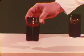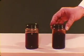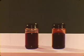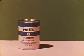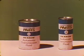In normal use, the original fluid should not require changing during the life of the vehicle. But for trailer towing or in taxi cab, police, and other heavy duty service, the fluid and filter should be changed as specified in the service manual. The Dexron type fluid used in Chrysler-made transmissions normally tends to darken with use, so fluid condition should not be judged by the color. When adding to or refilling a transmission, be sure to use only Chrysler-approved Dexron type fluid. Type F fluids can cause harsh shifting in a TorqueFlite, so don't use this type under any circumstances.